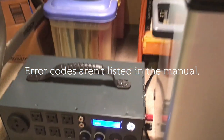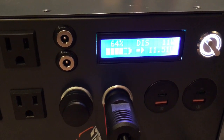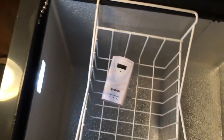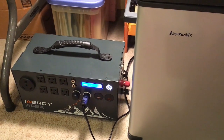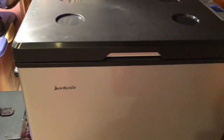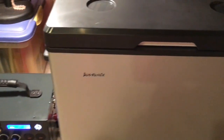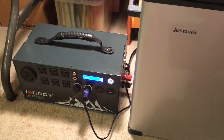I'm not happy about this, but I just wanted to let you know it did run for 24 hours and that's how much it took out. The 11 watts showing is just for the LED display — the fridge is already back up to 58 degrees, the light still comes on, but the compressor is not coming on anymore. I'll have to deal with that tomorrow. I don't think it has anything to do with the Apex — this is definitely a problem with my 12 volt fridge. I did get a five-year warranty so if all else fails I'll send it back, but hopefully customer service can help me out.